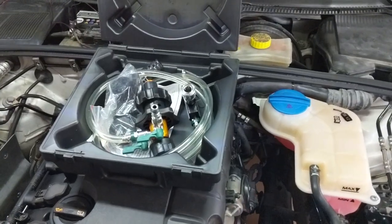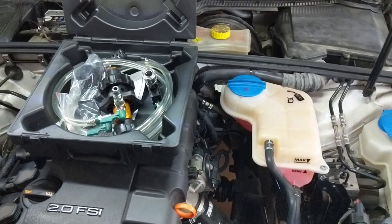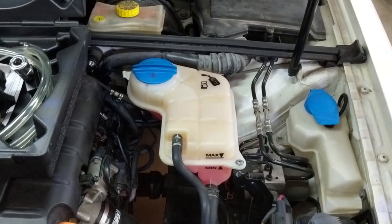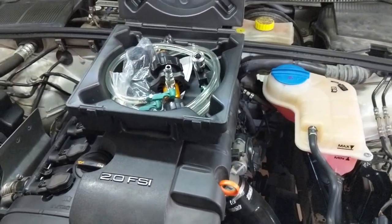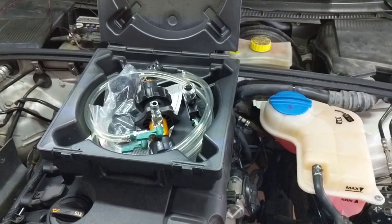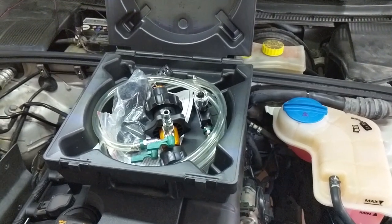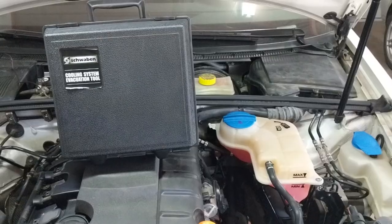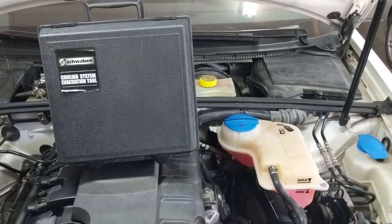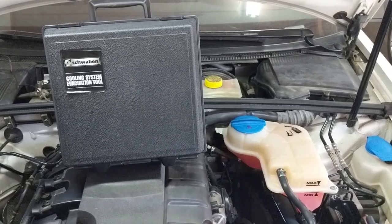That's a good thing — it means the air purge tool did its job and filled up all the areas, and I just need to remove a little bit of coolant. On the first go, the heater blew really nice and hot, and all I had to do was open the bleed screw and just a little air burble came out. The system is actually quite well bled. Now that the job's done, I can say I really like this tool. Most importantly it works, and the real value is measured in time — time you're not spending slowly filling the expansion tank hoping all the pockets fill up. Thank you so much for watching this review. Please subscribe if you liked this and want to see more.